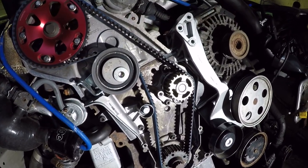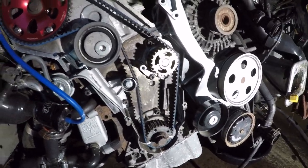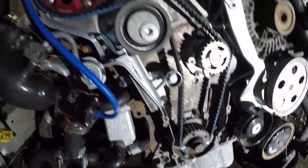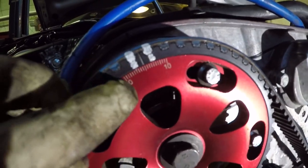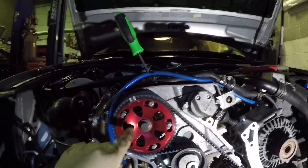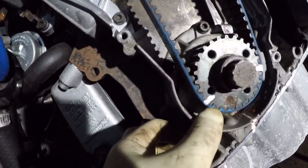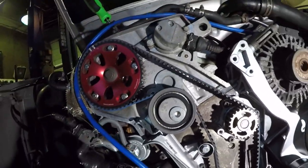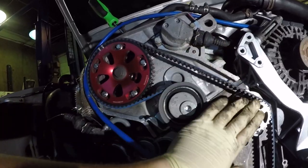I got the OEM and we'll see how long it lasts. What I did: I put everything on mark — I marked the crankshaft pulley, checked cylinder number one, and marked the timing belt teeth from the crankshaft pulley position. I marked here and here so I know how to put the timing belt back correctly. Make sure when you change it you don't slip a tooth, because that can mess up your timing and bend a valve.